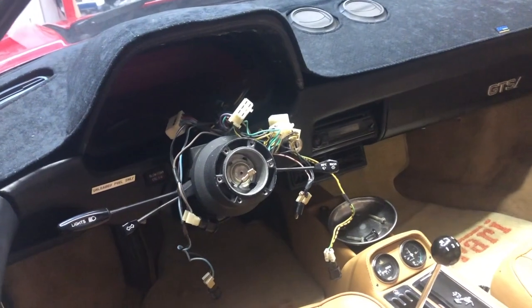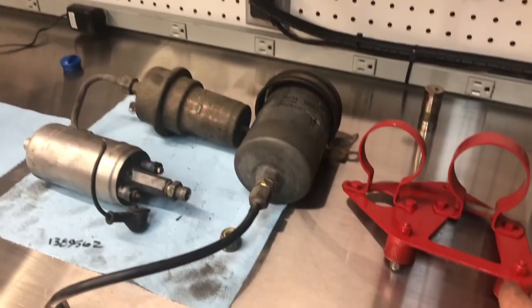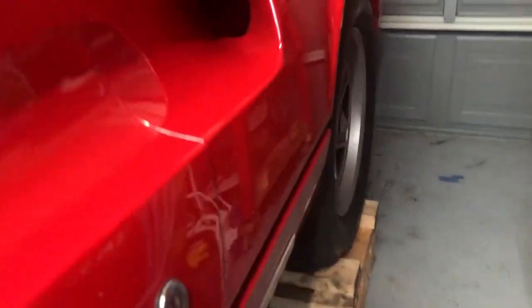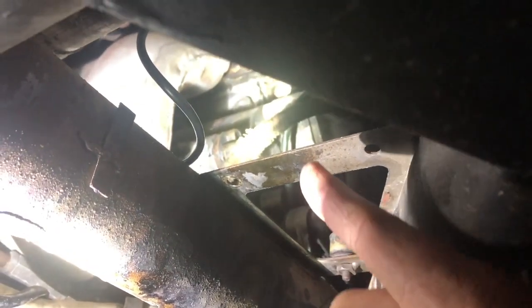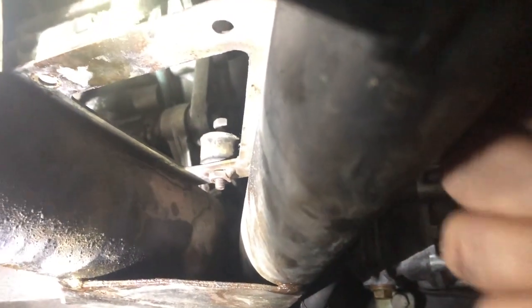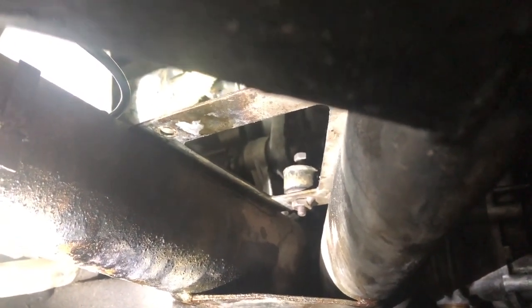To do that, I pulled the steering wheel and removed the instrument cluster. There's just four screws, and then I undid all the wires and voila, there it is sitting on the bench. Let me show you where this bracket is mounted in this car — it's really easy to get to. It's right up underneath, right behind the driver's seat, right up in this area here. That bracket bolts right on top of this right here — one, two, and there's the third bolt right there. The fuel pump and the accumulator sit in that bracket right on top. My fuel line is right back over here, just pinched off right now, on the side of the left-hand tank on the driver's side. You don't even have to pull any of the inner fender wells or any of that stuff. I just jacked up the back of the car and got it sitting on some blocks here for safety, and then went to town.